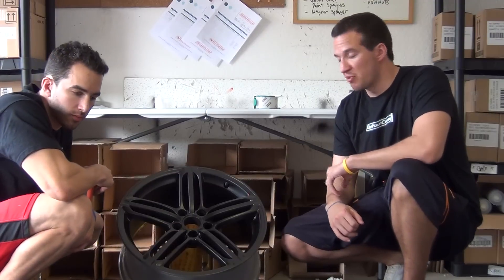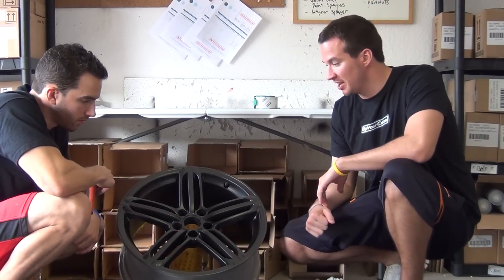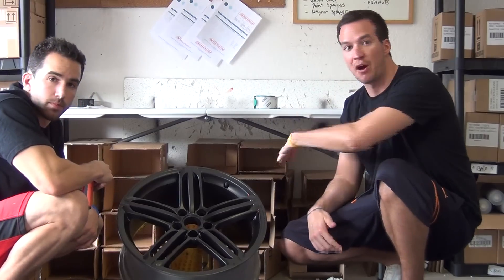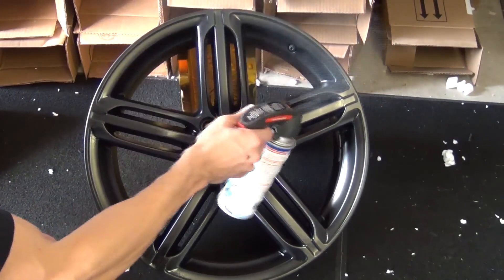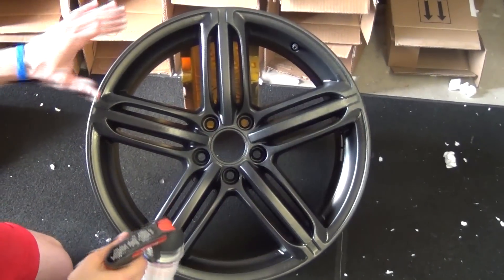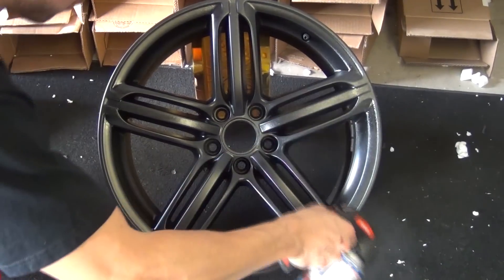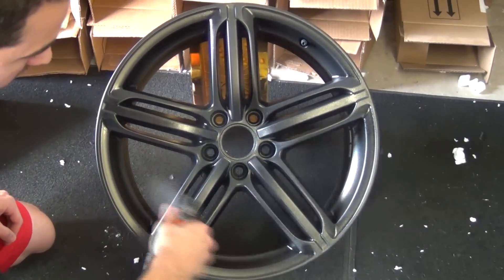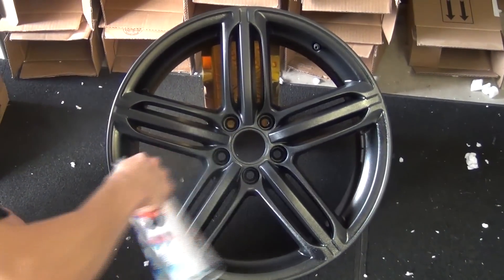It's real important to prop your wheel upright because instead of having the wheel flat on the floor, when you're spraying, you want to make sure that you're spraying out, not down. We're going to put our first coat of the silver metalizer on. Now if your intention is to just add a silver flake to your black, just be really careful because it really does add that silver effect very quickly as you can see. So we're going to give our first coat, which is a light dusting of the silver metalizer.